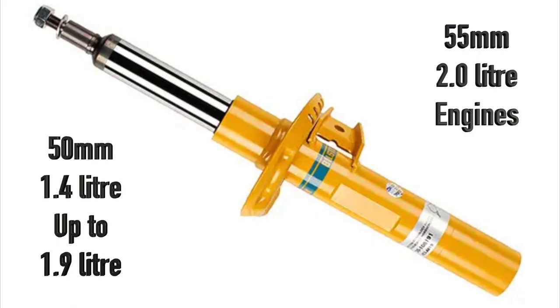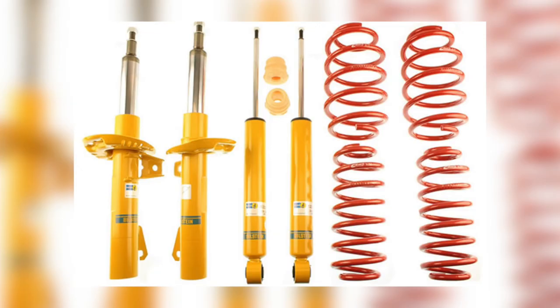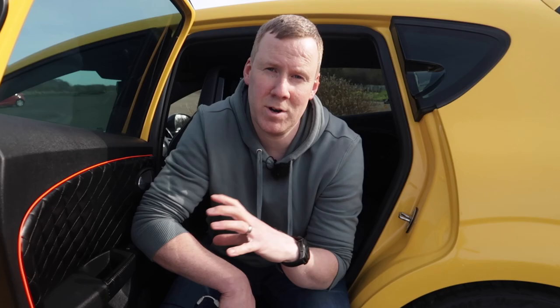When it comes to struts for this car there's basically a rule for the size diameter — you get a choice between 50mm and 55mm. All the engines from 1.6s and 1.4s up to 1.9s will use the 50mm struts whether petrol or diesel. If you've got a 2.0 petrol or 2.0 diesel you'll have the 55mm struts. This helps when choosing a new suspension kit. For well-known brands there's KW, H&R, and Bilstein — all really reliable. You also get Stance Plus for a budget coilover option. H&R are most popular for standalone spring kits. Also be aware that when I had a Bilstein B12 kit for my car, it came with springs for about a 25–30mm drop, but you can get springs in the same kit for a 50mm drop with a slightly different part number. So watch out — it's not just the diameter of the shock absorber that differs but also the part number for the springs.